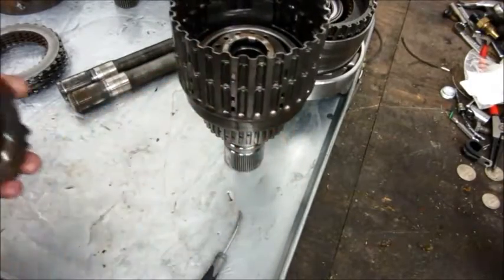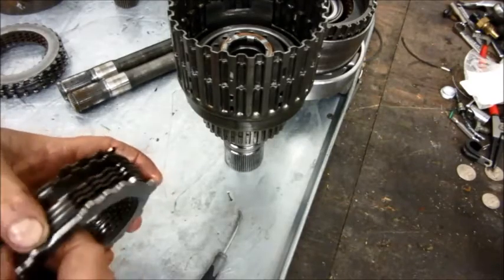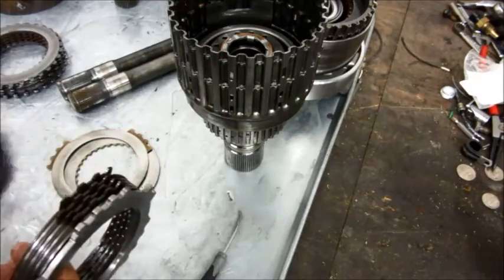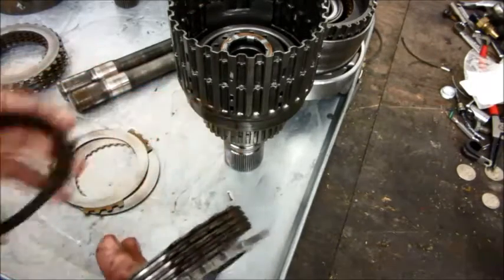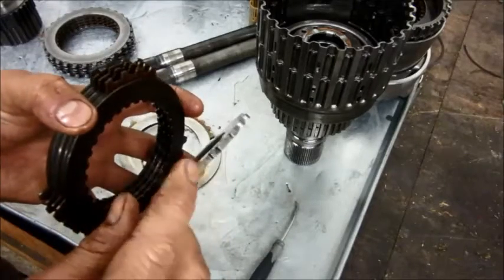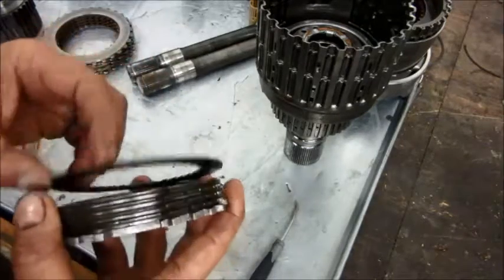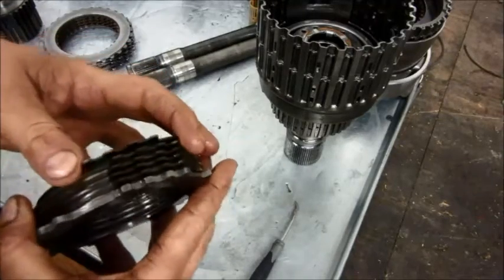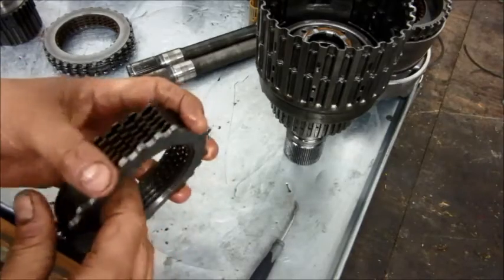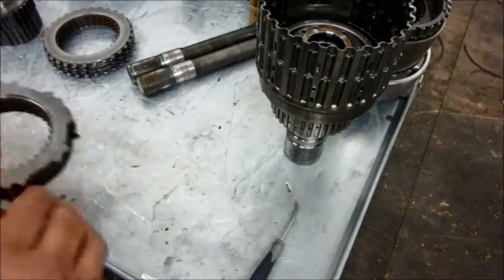I took all the clutches out of the input housing. This is the third clutch, and originally it had two fewer clutch discs — those were not there, this plate was thicker, and it had a wave washer in the bottom. I took that out and replaced it with a thinner pressure plate, and that allowed room to get in two more two-sided clutches, adding more torque capacity to the third clutch. Taking out that wave plate will cause it to have a much harder shift as a side effect, but in my opinion it's worth it, and I can adjust the valve body a little bit to help prevent it from being obnoxious.